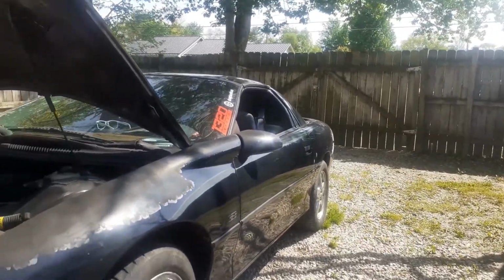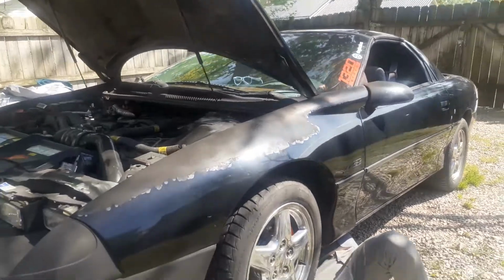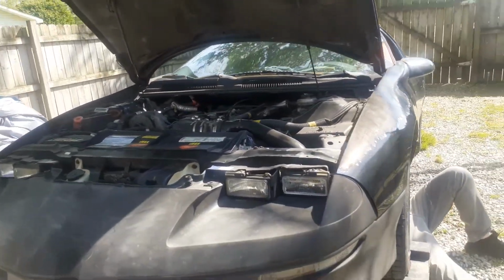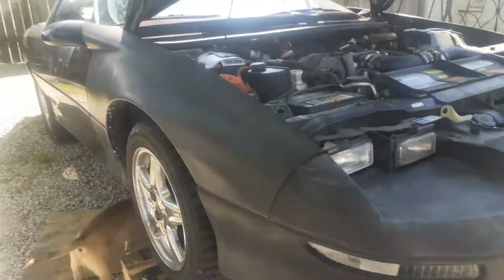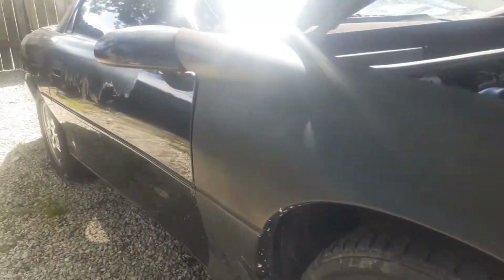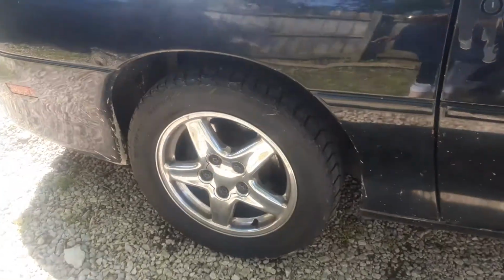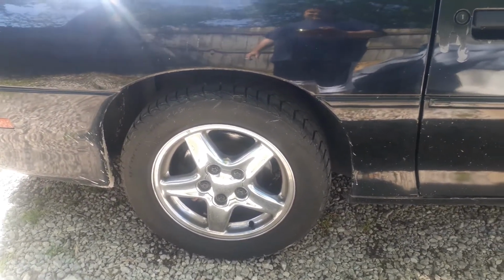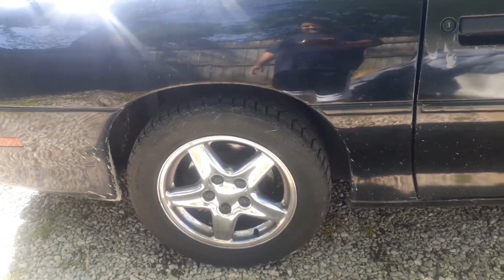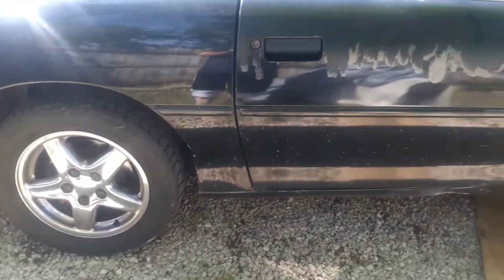That's why when you buy headers and Y pipe, you want to get the same brand together, because they are different. But this car, he did take it to the LTX shootout last year, 2020, and it ran a 13.0 spinning. You just had a street tire on it, didn't you? Yeah. Street tire. He was just running these street tires. Now, it was all over the place, but when it did hook, it ran a 13.0. But 14.6 the first time. Well, he'd run a 14, then a 13, then a low 13, but it was all the tires wanting to spin. But definitely needs some tires on it.